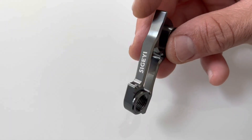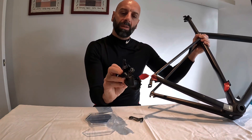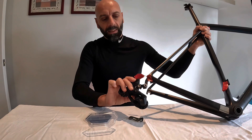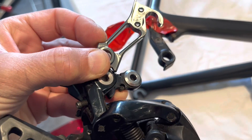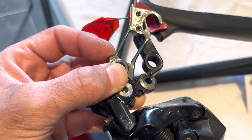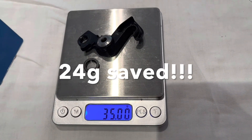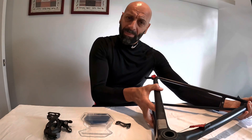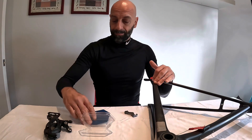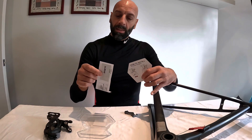The idea is to replace the hanger and avoid this joint here on the rear derailleur. So instead of being fixed like that, the direct mount hanger will come straight to the bolt for the derailleur, saving a very little weight, supposedly offering more precise shifting, but more importantly looking very pro and very cool — so maybe that is the only effect this upgrade will have. It should be hopefully easy even for someone not really gifted with technical abilities like me.